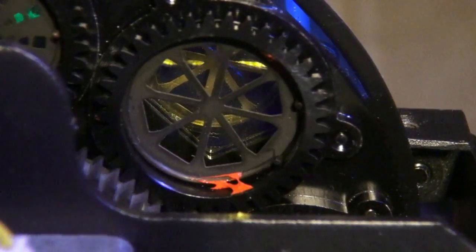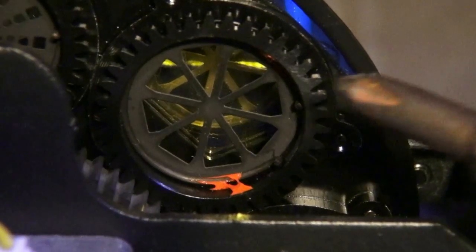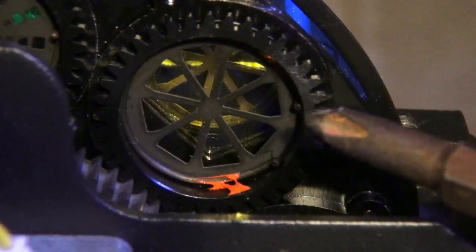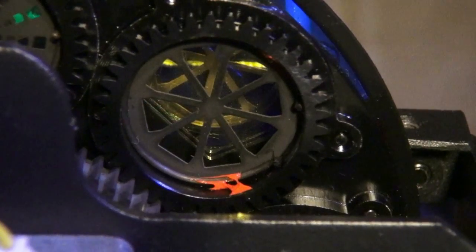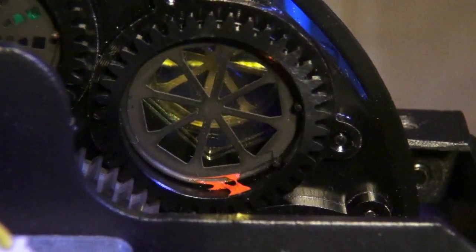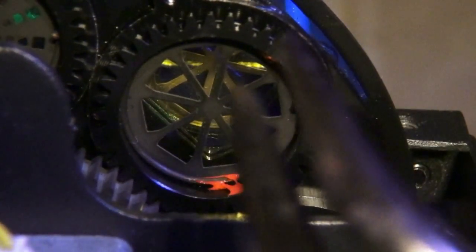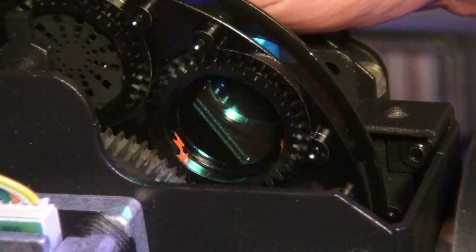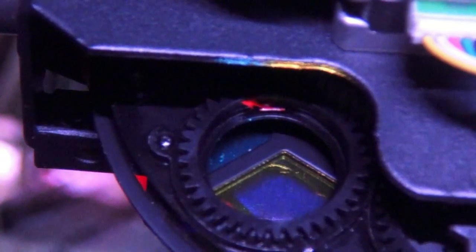This is the best area I found to work on to pull gobos out. This is the gobo we want to remove. If you look closely, you'll see a little clip that goes all the way around the gobo. There's a little part of the clip that sticks out — I'm going to grab that with a pair of pliers and pull it out. There we go — there's the ring, and the gobo came out with it.